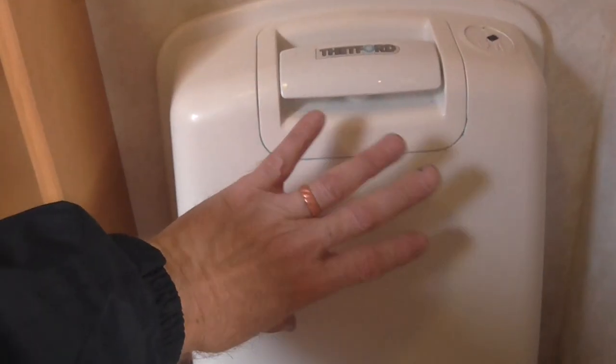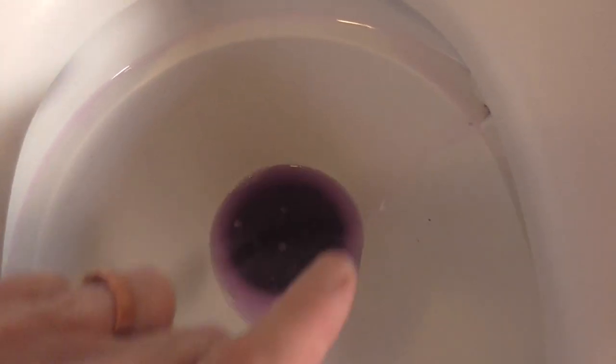And I've just filled this, remember that was the pink fluid from outside. And a little tip, when you've used the toilet and you've closed this gate back up, just run a little bit of water into it, because there's a rubber seal in here and it just keeps the seal from going brittle and losing its seal basically. So that's the bathroom.